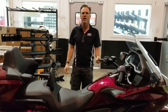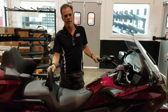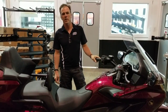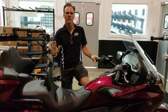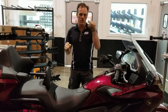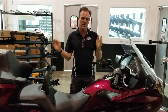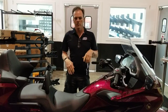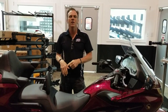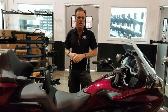These things are sometimes 75 or 100 dollars. If you're going to do that, just drill two holes in your own link — go to Home Depot and buy two pieces of metal. It's terrible. Why is it bad? That system of linkages and the rocker work to move the wheel and the shock absorber in a very precisely engineered fashion. People think it's a progressive rate linkage, but what it's actually doing is creating a linear wheel rate — not a progressive one.